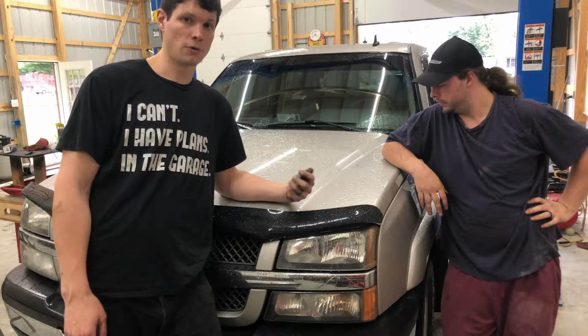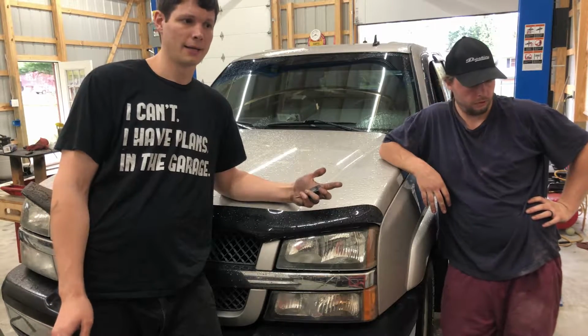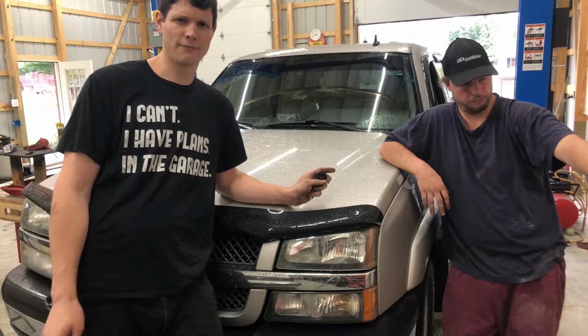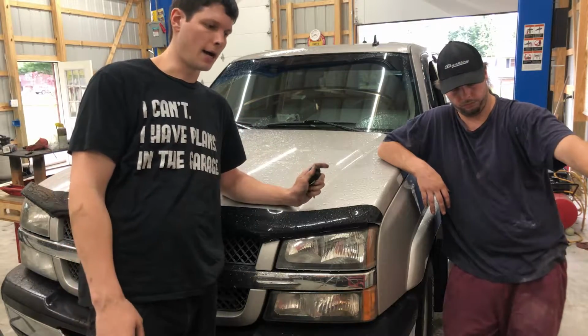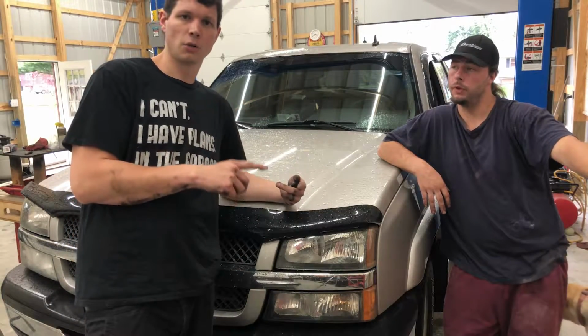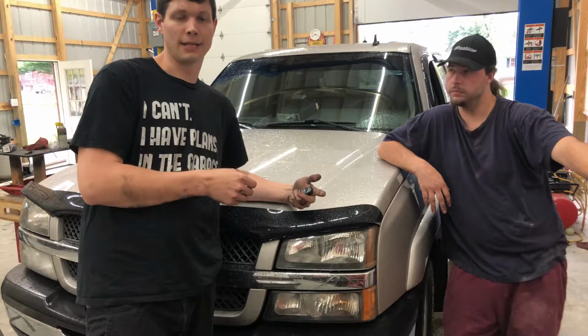So we're gonna do two things. I might split it into different videos, I might put it in one, I don't know yet. He also got a check engine light code for P0454, which is something to do with evap pressure, which may be due to corroded lines. But anyway, we're gonna be removing the drive shaft, we're gonna be replacing the rear output shaft seal on the transmission, and we're gonna be dropping the tank to diagnose what is wrong.